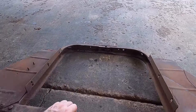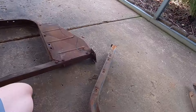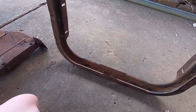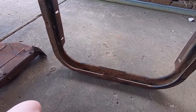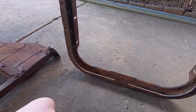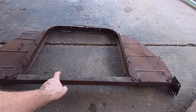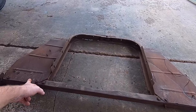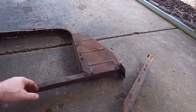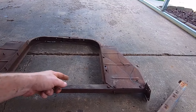The whole bottom of the core support is blown out - rusted away on the bottom. But I knew I had one of these in my shed, so I dug it out. I thought it was for a six-cylinder but it's actually a V8 one - that's okay, I can modify it. For mock-up I'm going to replace this. I'm basically only using the upper bar and these two outer panels, which I'm hoping I can hammer and dolly out. I kinked it getting it free but I'll probably end up making new ones anyway.